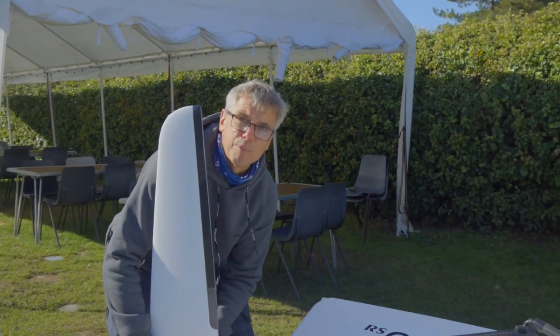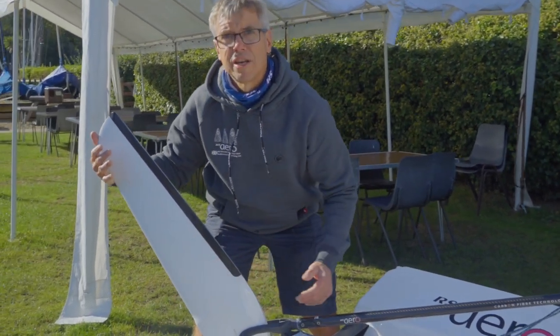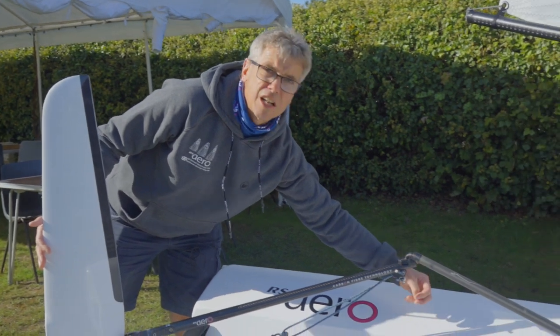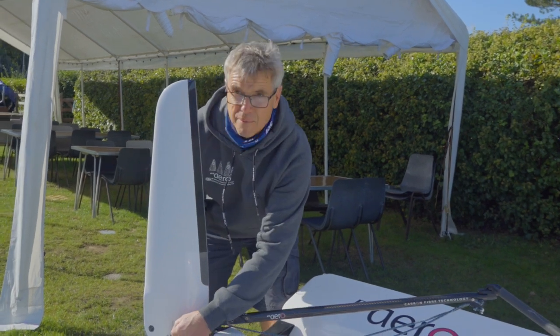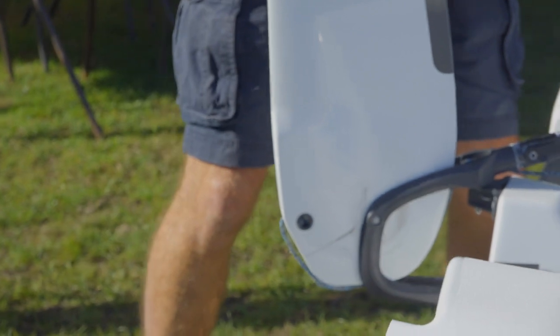The first thing I like to do is get this bolt nice and tight so that your rudder doesn't go slamming down onto the concrete. Also, if you're going through shallow water, you can uncleat this and the rudder won't come up unless you do go aground, or maybe you're planing flat. So that tightness of that nut is critical — just tight enough so it doesn't fall down.